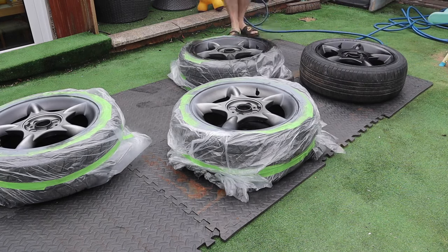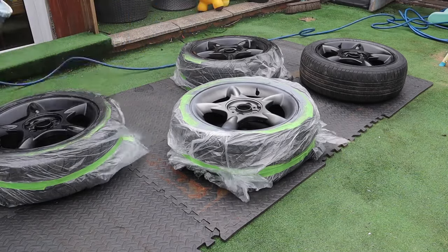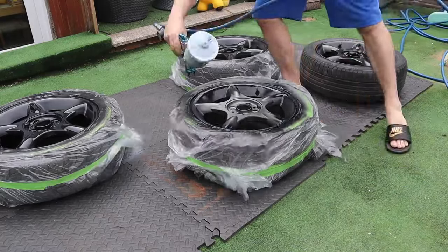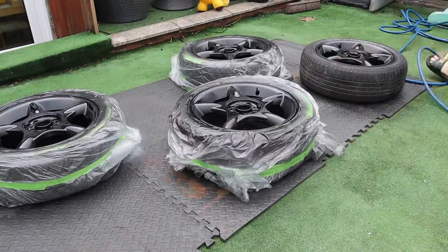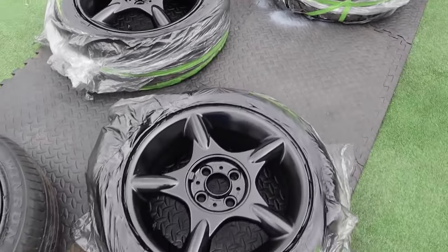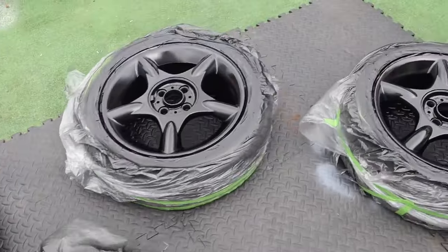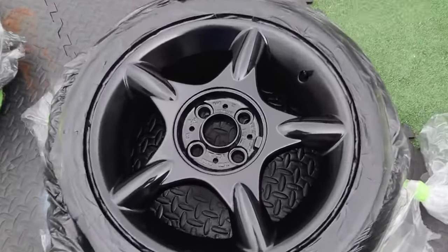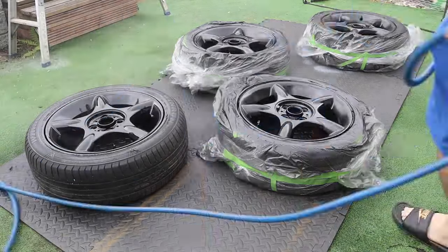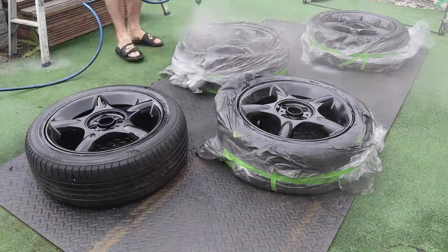In total I applied three coats to the barrels and then flipped the wheels over and applied a further three coats to the faces — the first coat being quite light, the second a little bit heavier, and the third heavier again. You want to give it a good 10 to 15 minutes between each coat if you're doing it outside. As the base coat dries you should notice it starts to go more of a satin or matte finish — this is because we haven't applied any clear lacquer yet. Between applying your base coat and your lacquer you want to allow at least half an hour for the paint to dry so you don't trap any solvents underneath, which would just dull down your finish.